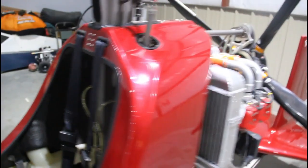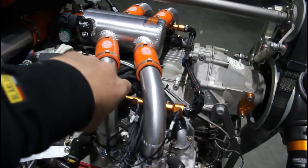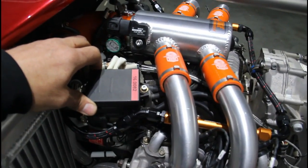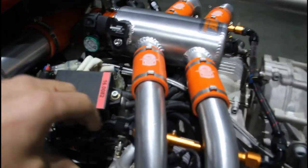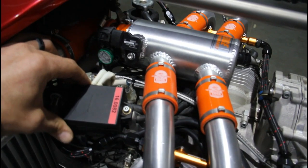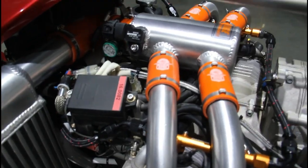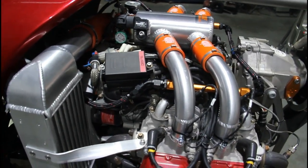Returning just back to the tank. Obviously the fuel injection plenum — we've got the inside the rail injectors; that's called our Trixie intake. These ignition modules get relocated a little bit to the side to make room. The carburetors always sit kind of on the side, so the coolant bottle and these modules always set more toward the center, so we've got to relocate them out. The wires don't need to be moved or lengthened — they have enough room in the loop to just scoot over and out of the way. Part of the kit is also the new brackets that allow that to mount in that location.